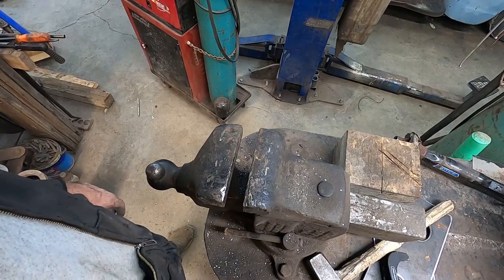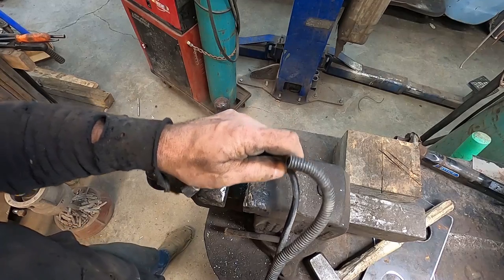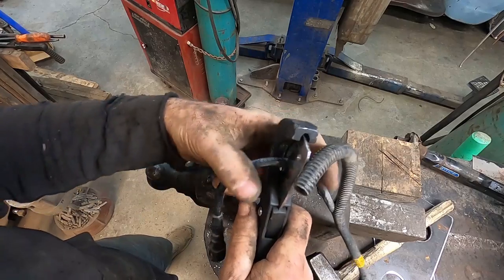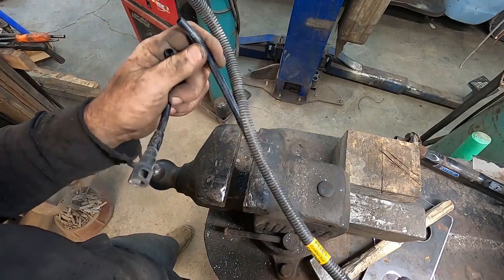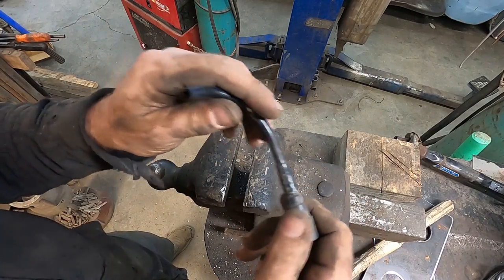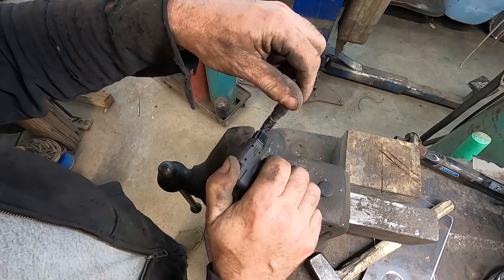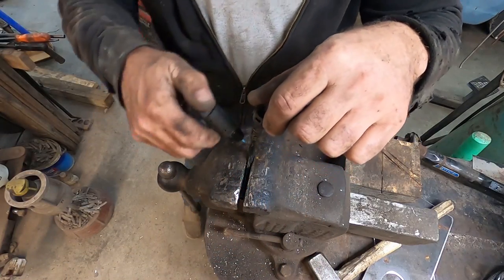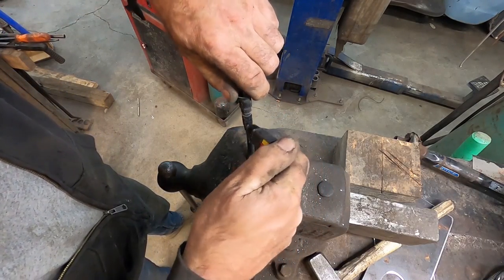We are doing the fuel system and we're doing push connects. I have talked about this a lot before, but I realize there's probably a lot of people here who have never seen any of this. Anyways, I have this random chunk of line that came off something. It's got the 5/16 end that I need, and this end is still good. We can reuse these if you heat up the end, like I reused the push connects. They're readily available, but if you can reuse them, why not?